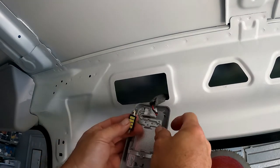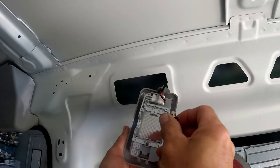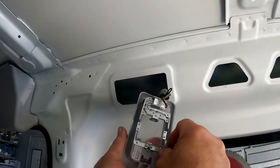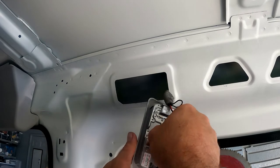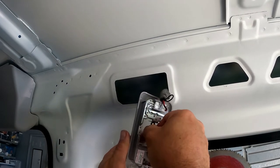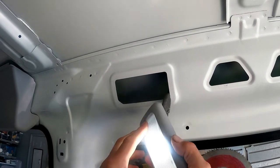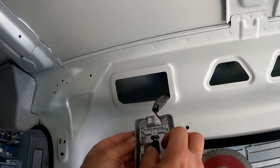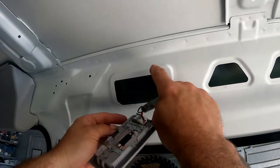When you put this back in, you just have to remember that if your LEDs are facing towards you, that's the wrong way because you're actually looking at the back of the fixture. I'm going to push down a little bit, lift it up on the top, push down on the bottom, and it just drops right back into place. You can test it first — flip the switch on, flip it off, so I know it's working. And again when I put this back in, do not touch the metal to the metal.